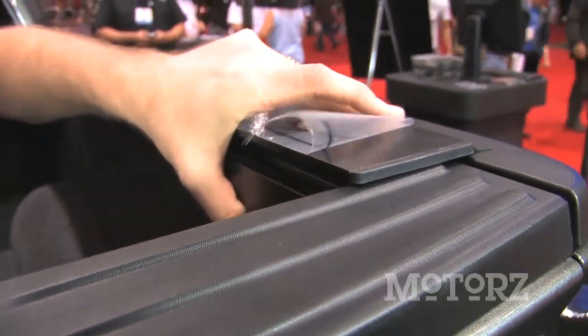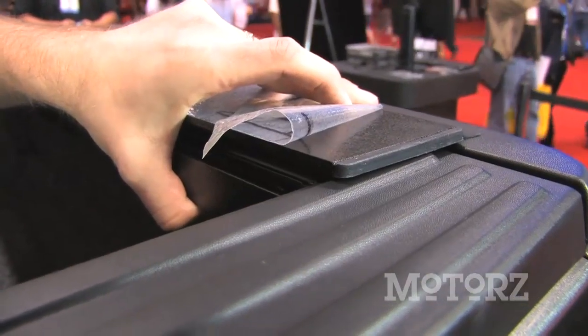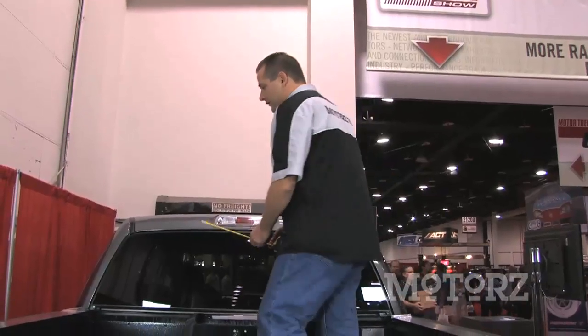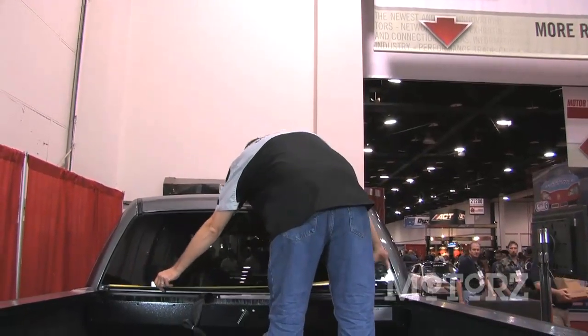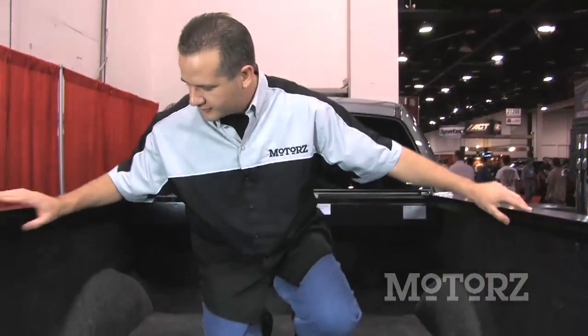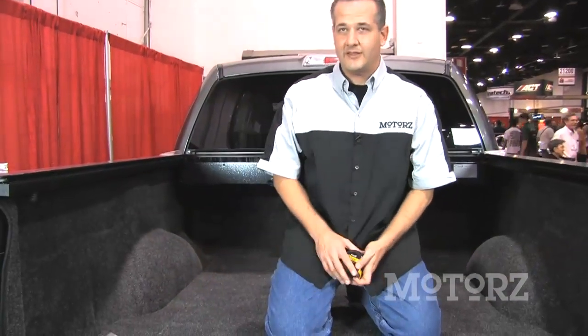Check for the amount of space that you've got down there. A little bit of a gap. Measure the width of the cover. We measured exactly 57 inches. Now you want to move these guys in because you want 57 1/8. You want about 1/8 inch of play.